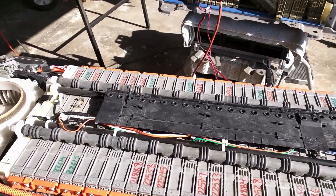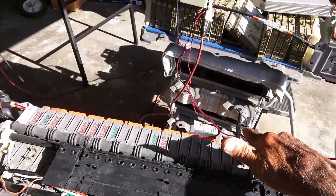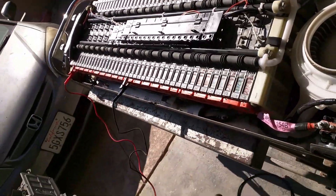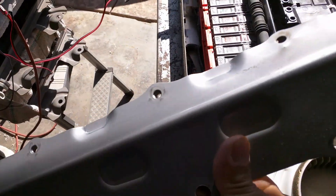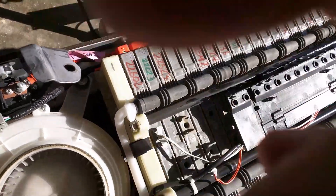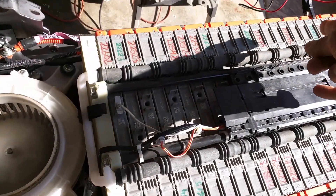Please don't charge this side thinking this is positive and this is negative — that's the wrong polarity. The correct polarity is on the other side, so you have to be careful. Also on this side, as you can see, there is a skirt plate attached across the body here with about seven or eight nuts that you have to open. But when you're charging inside the vehicle, if you don't want to remove the skirt plate, you can just remove the top plastic covers, attach the clips, and start charging.